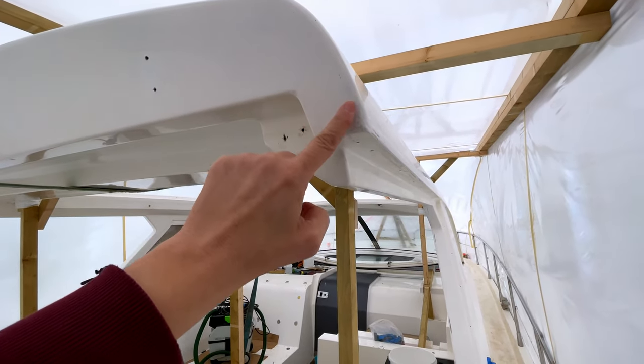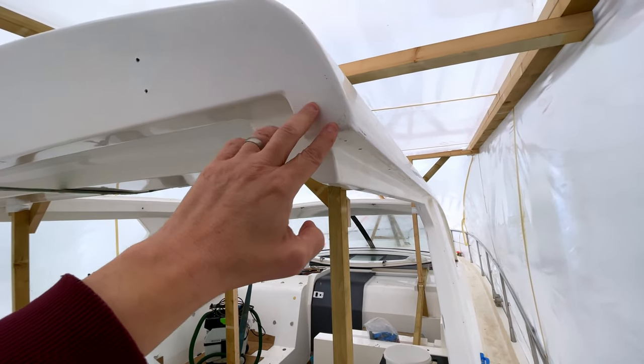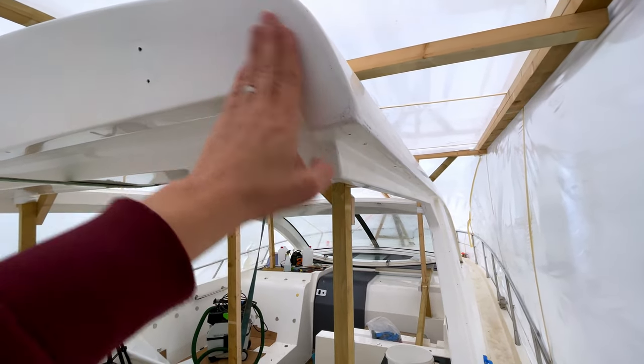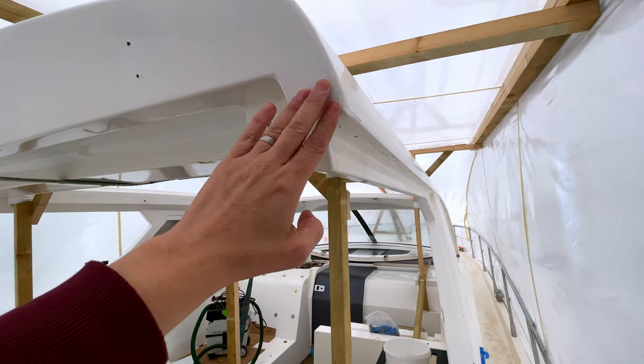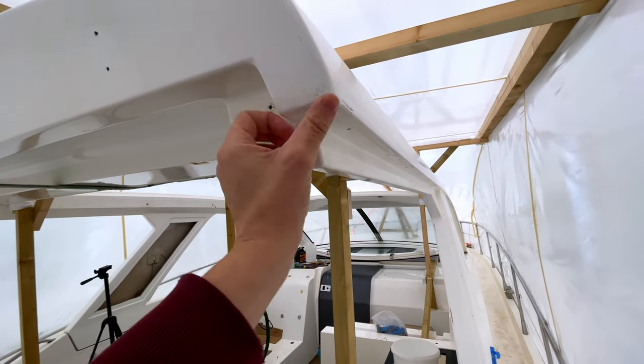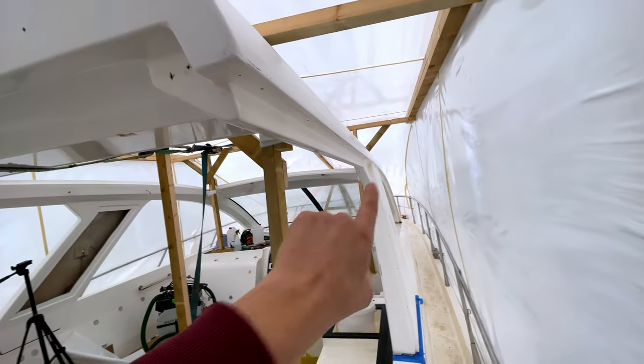And what they've done is they've brushed on gel coat in certain areas to cover that. And then I think because this was never retailed as a boat, they've not bothered finishing this. They've not bothered flatting it and polishing it, which is what they normally would have done. So we're going to have to just finish these pieces here first before we can paint, but that's not a problem. And we actually think this top part was molded in four pieces.